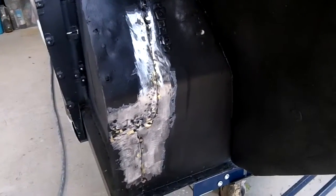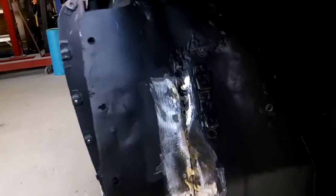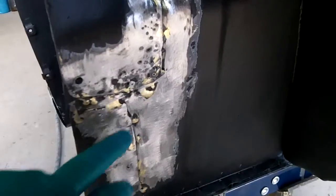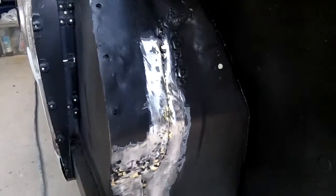There's a previous owner repair that Ron at the wrecking yard would be proud of — although we don't talk about previous owners. Anyway, lots of brazing, lots of rivets, lots of laying over of metal. I know the correct thing would be to cut this out and replace it, but I'm going to make it better than it was, and that's my only intention. We're going to get a little fiberglass filler, fill up this void here, and then do a few coats of Bondo over that, and we're going to call it good.